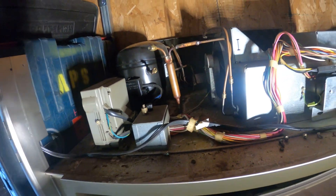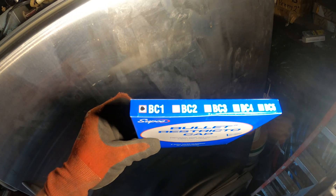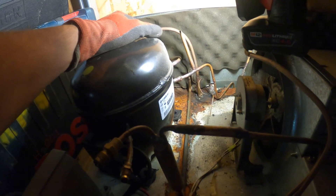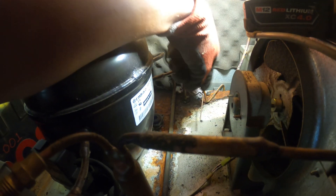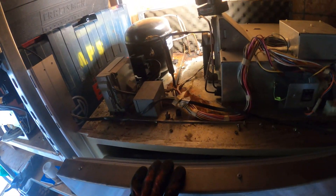I looked at the model number of the compressor and it is a quarter-horsepower motor. This is a Supco BC1 capillary tube, rated from one-fifth to one-quarter horsepower. The capillary tube acts as an expansion valve for small systems. Here's our condenser, the condenser fan, and the coil is inside. Following the liquid line into the expansion valve — our capillary tube — it then goes down into the evaporator. Let's open that up.